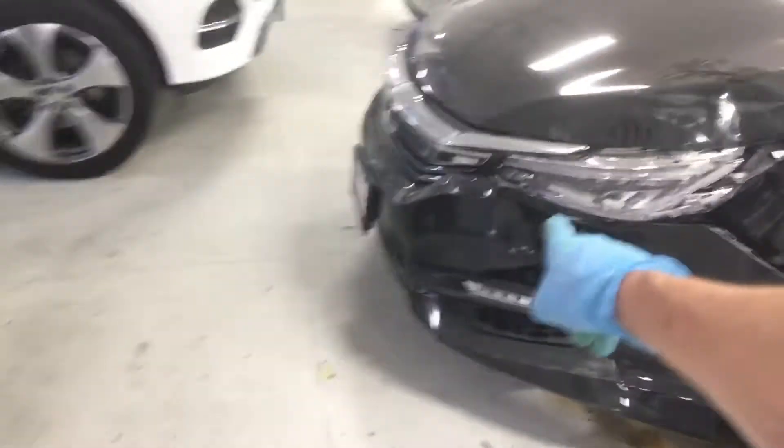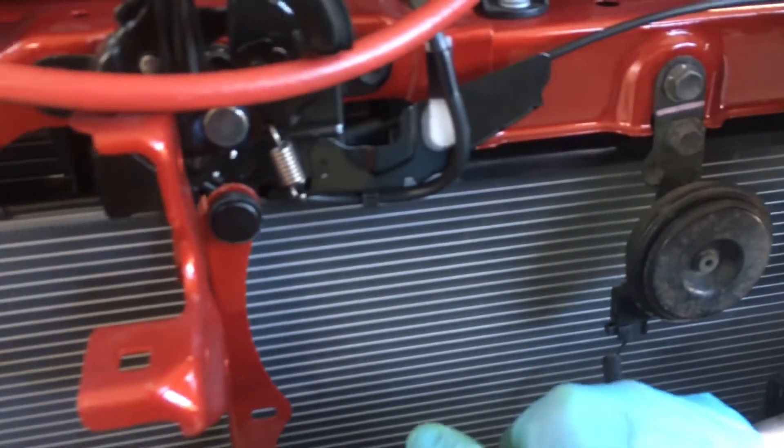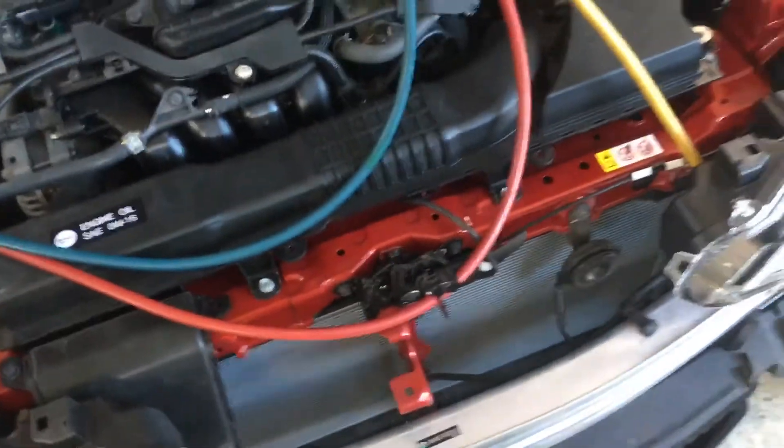And this is another one I'll be doing — taking apart this one. I got two more going on here. I got to get approval for that one. Looks like they'll be doing the core support, taking that down. This one I'm pulling the vacuum on. This one is a YF refrigerant — this was the one with the broken little clip, the Toyota little plastic clip. That's the Toyota factory condenser. You can tell the fins are very small and very uniform — you have almost 20 to 21 fins per inch. And you have 50-some tube count. This is a really good condenser; it's not a cheap aftermarket one.